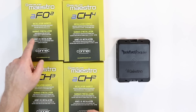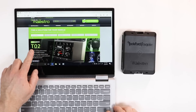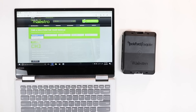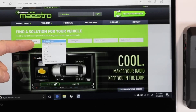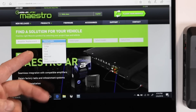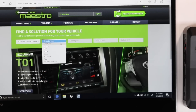For example, what we have here is a Ford and a couple of Chryslers. If you go to the iDataLink Maestro website, you can type in the car that you have. First you select a project — go to Amplifier Replacement — then select Make. As you can see, available makes include Chrysler, Dodge, Fiat, Ford, Jeep, Maserati, Ram, and Universal mode. They're also going to be adding GM and Toyota, so check frequently to see if your car's manufacturer has been added to the list.